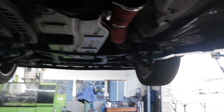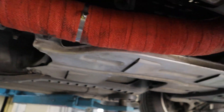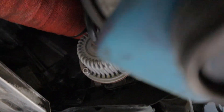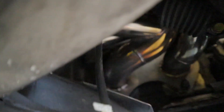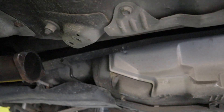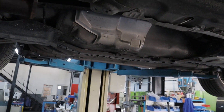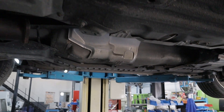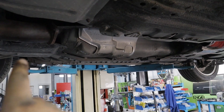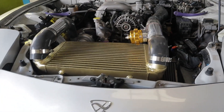We need a mid pipe and the downpipe. The downpipe is roughly in the right position — as close as I can get to the turbo right now. It's sort of in the right position and then I just need a mid pipe made up. This is about a metre length plus or minus. And this is going to be a straight pipe — I'm not going to put any silencers or anything like that. So we need something from there to there. Still waiting on Russ to come back to help me out with the downpipe.